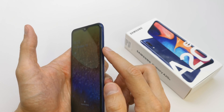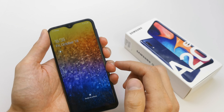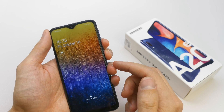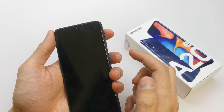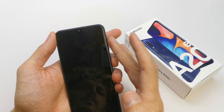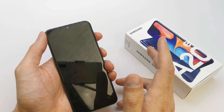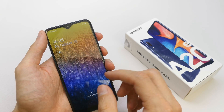You need to press and hold volume down and power button for a few seconds, then the phone is going to be turned off. Then fast press and hold volume up and power button together. After the phone wakes up, release volume up while still holding power on. It's a little bit complicated but just watch my hand and do the same things.